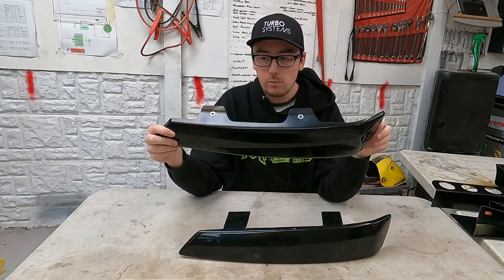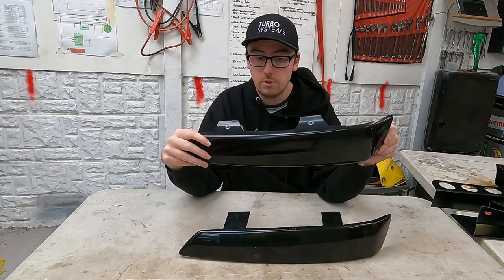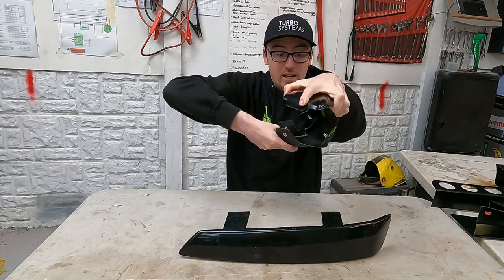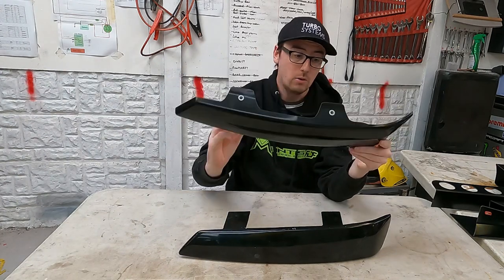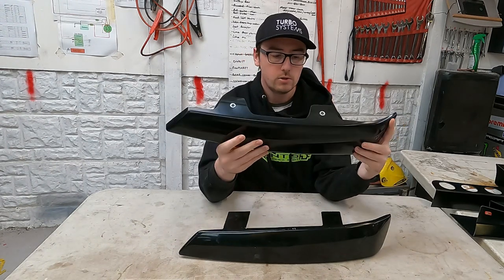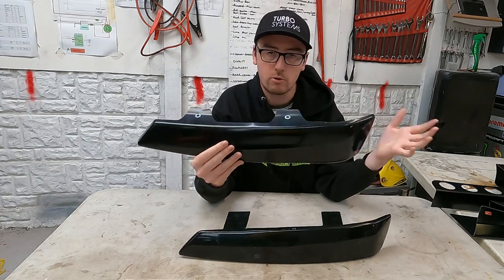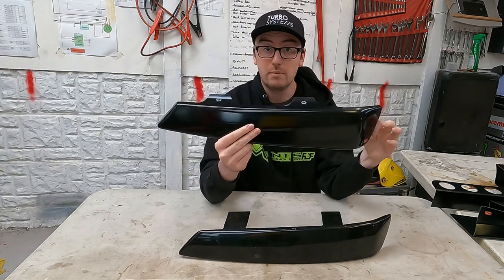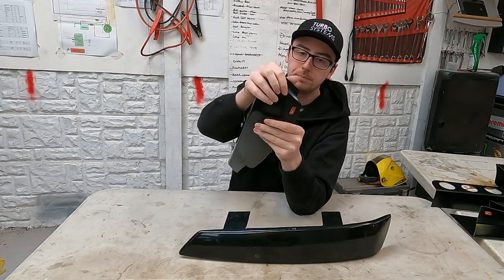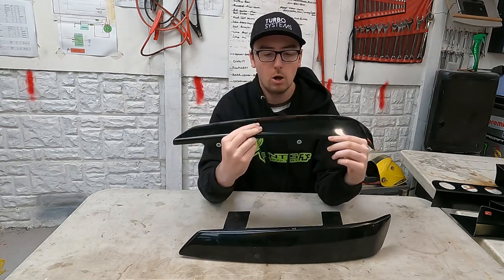All of Eugen Factory's parts are made out of plastic, so they all share these characteristics — which is super important to mention. With the plastic headlight blank I can grab it and twist it like this — look at the amount of flex you have. We have gotten some stress marks here from flexing it quite aggressively, but a bit of a heat gun and it goes back to flat again. Your flexibility options with these are incredible. If your car is bent — and all Nissans are nowadays, we've all crashed about 50 times — this will fit because you can use a heat gun to bend it into shape. It's got a really nice lip here to slot in behind your front wing or fender.